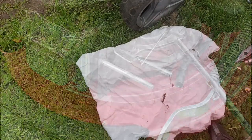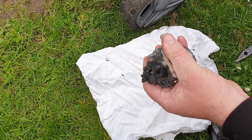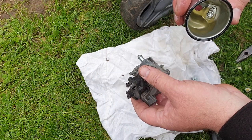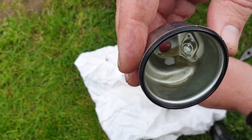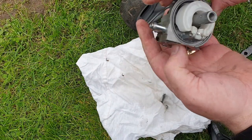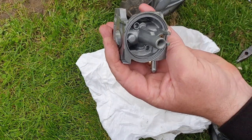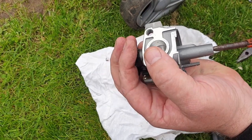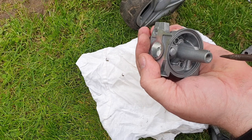Onto the lawn for a quick little clean. So our quick little carby then — he said he left the fuel in from last year. Tip it off onto its side, drain the fuel out onto the rag, undo the first nut, drop the bowl off. Now it's really, really... there's a little tiny bit of dirt right at the very base of that carby. A little bit of grass in there — you see it? Really small amount, but that's good. We'll give that a clean with a bit of WD-40 in a minute. And then we've got a little tiny float pin — we're going to remove that, take the float off. All I want to do is grab the jet out of here. A flat-head screwdriver goes in and I just want to remove that jet, if it's the right size screwdriver. Is that moving? I don't think it is — wrong size screwdriver. Let me go and get another one.